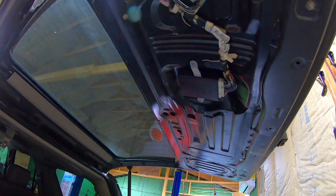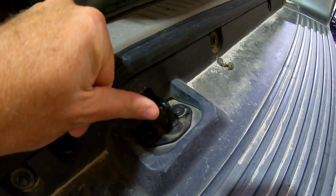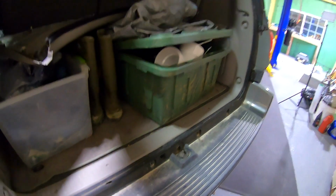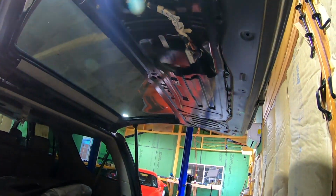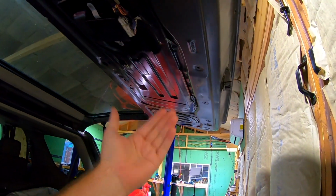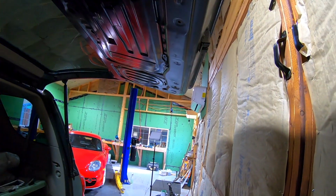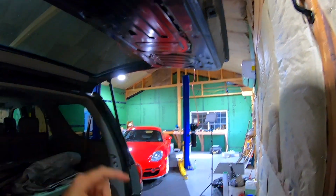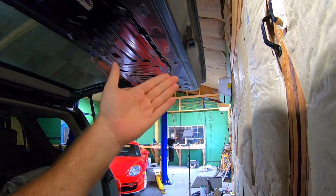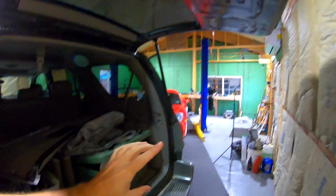I got to reading that we need to flip this around, take the 2 bolts out, flip it around, because what happens is that post gets worn so bad, it causes a problem, and that latch drags on it, and it can't unlock. Because I could hold the latch in my hand, push it in there, and it would function right every time. I mounted the latch back in, I still had this unbolted, I could stick that in there, and I could function everything perfectly with the remote, never stick, right? So once I flipped this around, it's never stuck ever since.